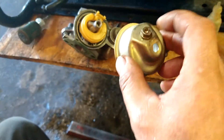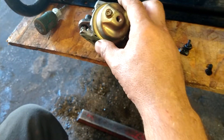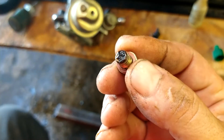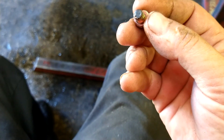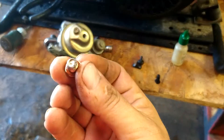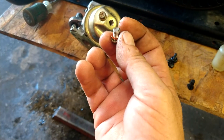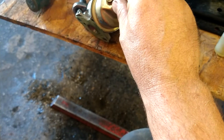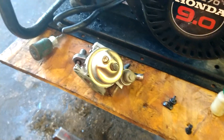Point the drain away from the other components, put the bowl on, and tighten the bolt down — make sure that little red gasket is on it. Clean any tar off the bolt before screwing it in. If you leave a tar bubble on there, fresh gas will loosen it and it'll suck right into the jet — and then you're screwed. Tighten that bolt down with the 10 millimeter.